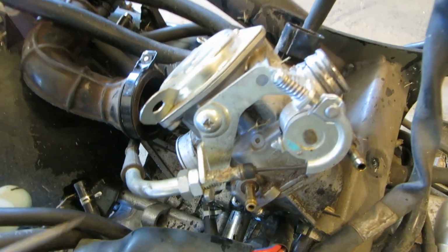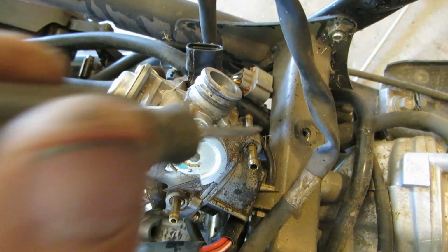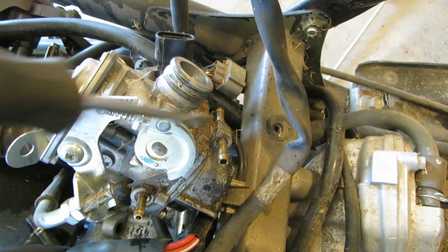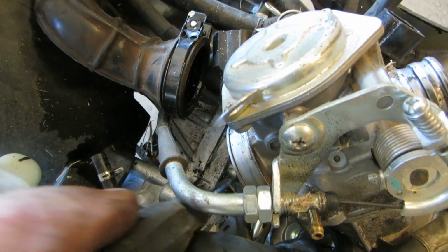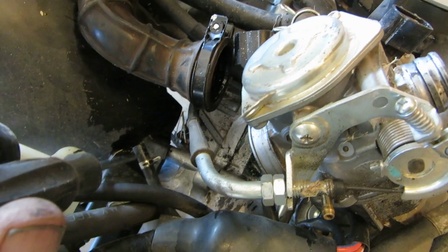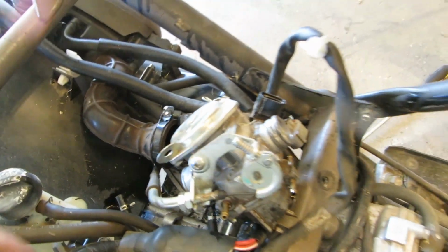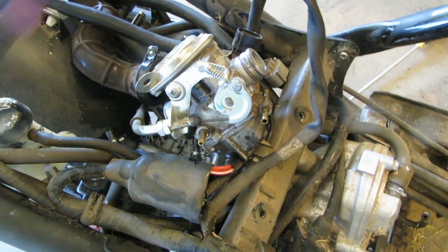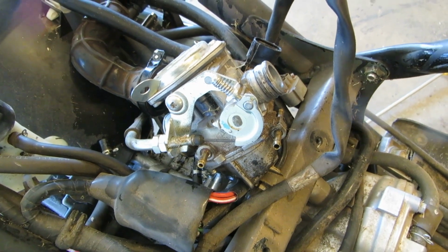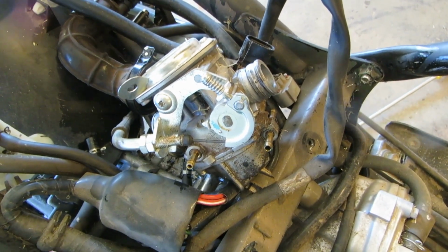No, I was wrong. Going in and going out, it has a circuit that goes around the carburetor, and if you look down there, there's blue. Do you see the blue? That's antifreeze. There's our fuel line right there. There's no return on the fuel line. It has a water-cooled carburetor because it's sitting over the engine, to keep it from getting too hot and the gas evaporating in it. Trick. Only the Japanese.